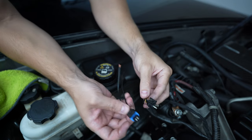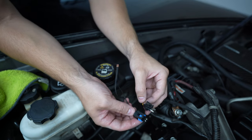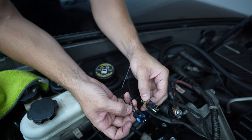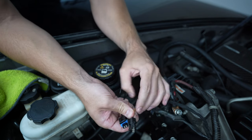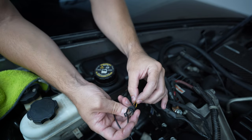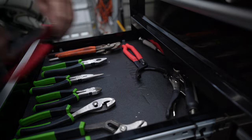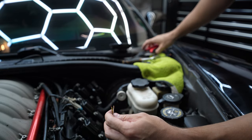The new pigtail is a little bit larger, but I've already lined it up and it plugs in just fine. There's a darker orange cable which is essentially wire A, and then a lighter yellow which is wire B. I'm going to slide the heat wrap back a bit, leave the wires at this length for now, splice them together, plug it in, and see if I get a good signal.